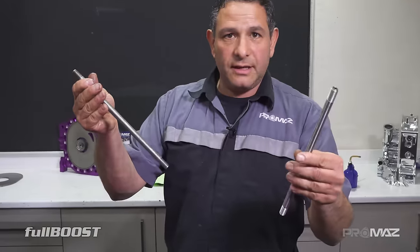This big engine is nearly complete. When we tighten the front nut, we're actually forcing the taper of the front lobe onto the main shaft — so this has to be very tight, 270 Newton metres. Do you hear it turn over for the first time? It's always a good noise — nice and smooth. Feel the two shafts moving. The end float spec is 0.04 to 0.09 — I've previously checked it so I know it's perfect.